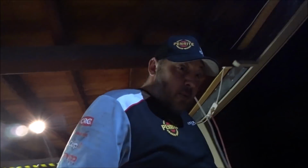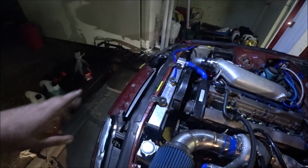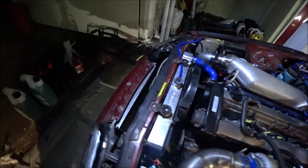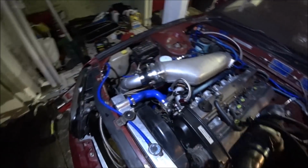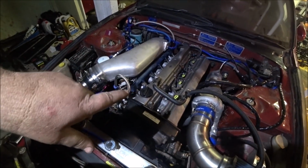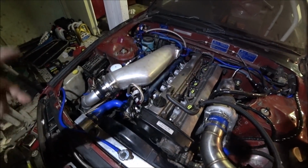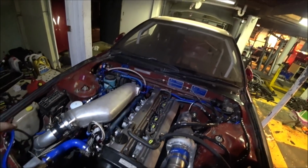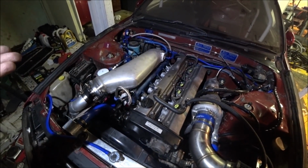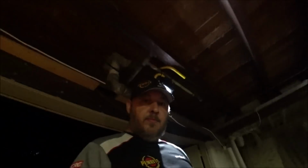Well, despite a leaking radiator, not being able to put coolant in it, we are pretty much buttoned up. Gonna see if I can find a radiator tomorrow and get it fitted tomorrow afternoon, because she's booked in for Friday. Today's Wednesday. About to just pop the spark plugs out and spin it up with the fuel pump relay disconnected to build oil pressure before trying to start it. Plug that in, put the coils in, start it.